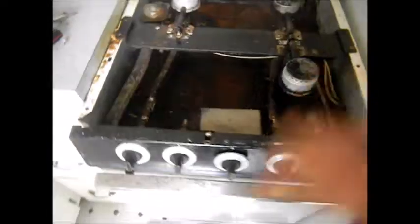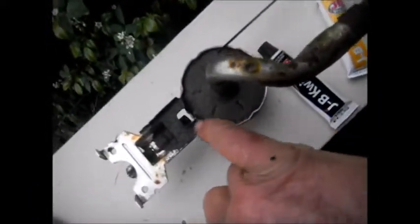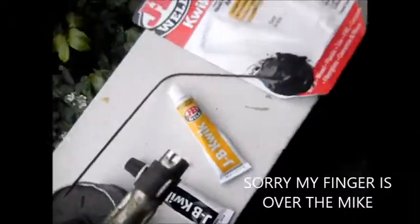Okay, so it's not ticking anymore. That's good. I don't hear any ticks. Do you? Okay, so what we're going to do is we're going to fix this one. See how it's really corroded around the edge? There's a big gap there. There's a flame that comes out there. Take some sandpaper, clean it up a little bit. Took some electrical cleaner, sprayed that on there, buffed it up again with the sandpaper.